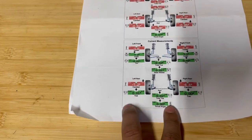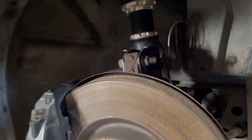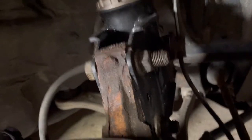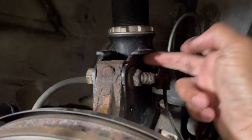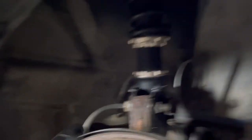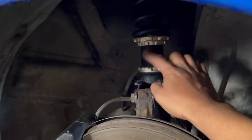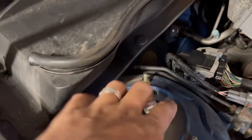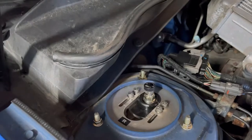So next steps: I'm going to loosen up those two bolts, push them out, the strut will come down, and that gives me free range to turn the bottom collar and raise the car by increasing the distance between the perch and the collar. After that I'll grease the threads, put on the coilover cover, and fix the camber adjustment up top — loosen the allen key and shift that eccentric over.